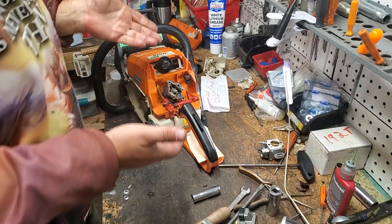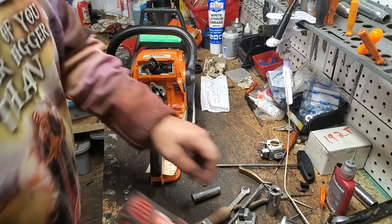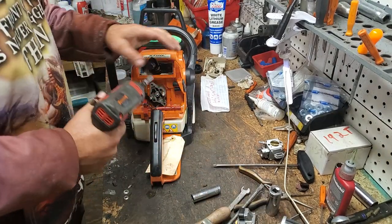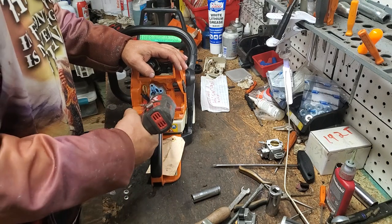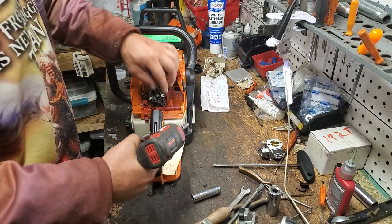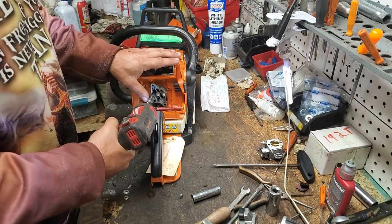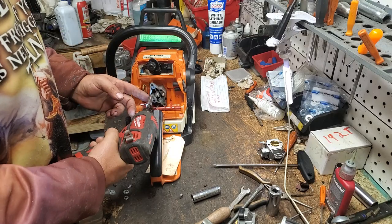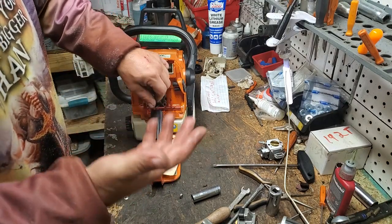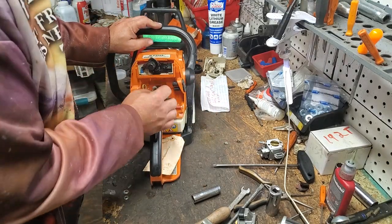There's some coffee. So, that's going to be it, neighbors. I have to tear this all the way down, and I have to go ahead and redo the base gasket. If I can clean them up good enough, I will probably reuse the crankshaft seals because they're brand new. They're not what's leaking. It's the base gasket around them that's leaking, okay? And that is the other thing. A lot of people say that you don't need to Permatex around the outside of the crankshaft seal. But I think you do, especially on these clamshells, these split pans, whatever you want to call them.